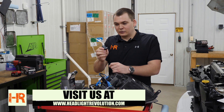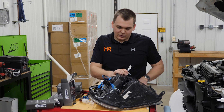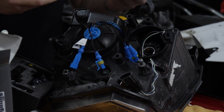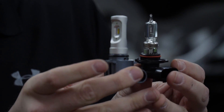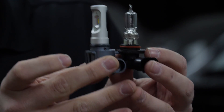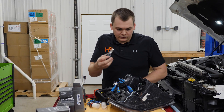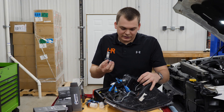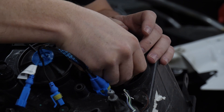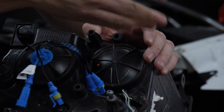Most people run something like the Supernova Perfect Fit bulb. If you wanted to go that route, we've got it as a vehicle-specific kit for these Rams. Remove the dust cover, disconnect the harness, pull the bulb out — here's a little side-by-side. You can see why they might call it the Perfect Fit: it doesn't have any fans or extra wires and looks just like a factory halogen bulb, except it's significantly brighter. This is how much easier the LED bulb is to install — plug it in, twist it in place, dust cover in. That's all there is to it.